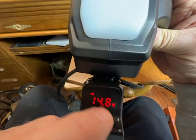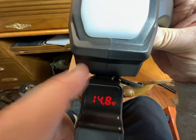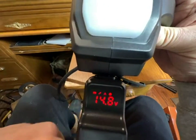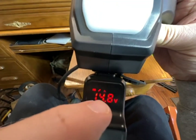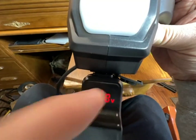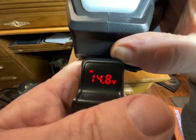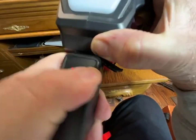Some other things that can happen is that the battery has short-circuited, and often that's because one of the plates has corroded and shorted out against another one. The plates can also die in the battery, which will cause a battery failure. And very often you can't jump a battery like that. And this will tell you; the codes are in the manual.